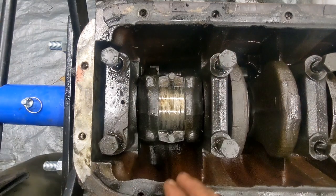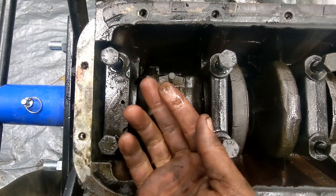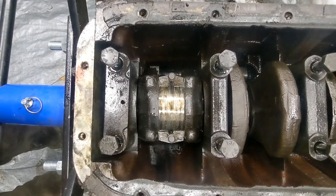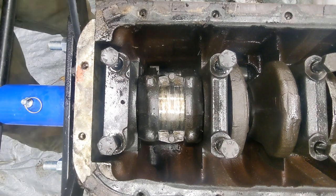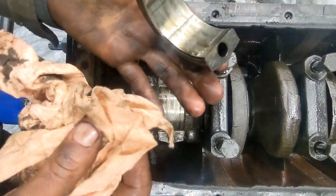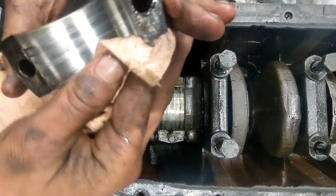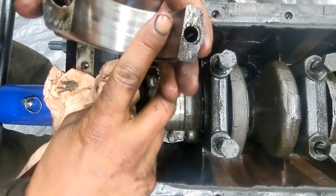That's what I was expecting to find. The main bearings weren't that bad - they're bad, they're not good - but not that bad compared to this. You can see the chunks on my finger. It's so rough. This is the cap off the piston and you can see all those sparklies - just chunks of bearing. You can tell it was sitting there spinning. It definitely spun the piston bearings.